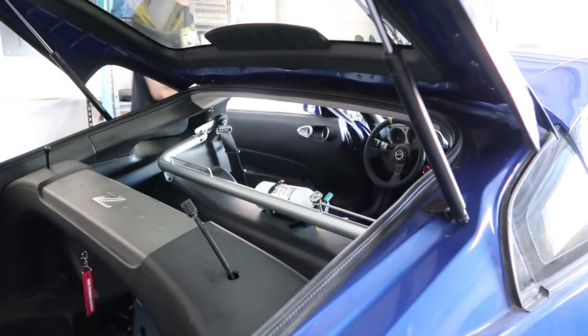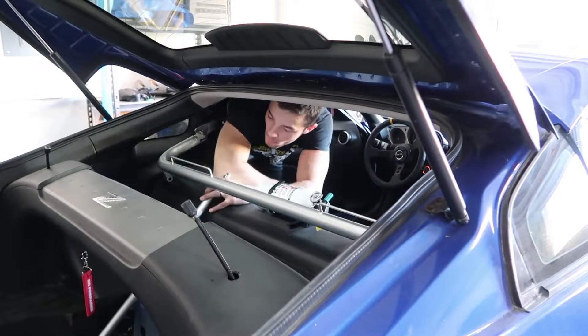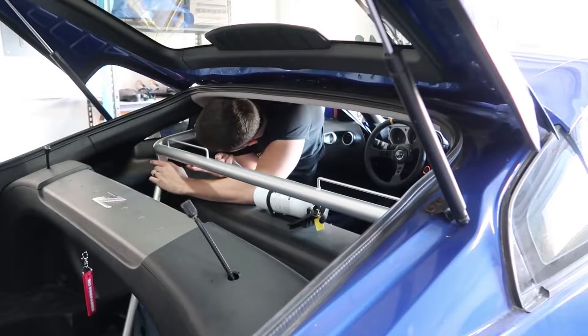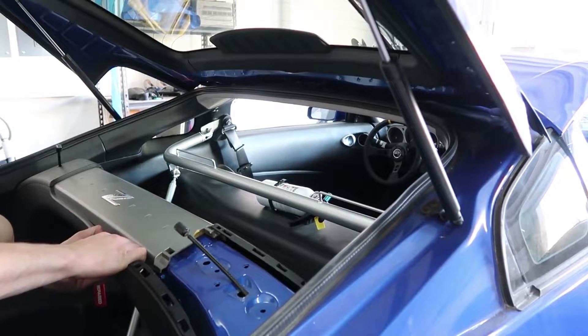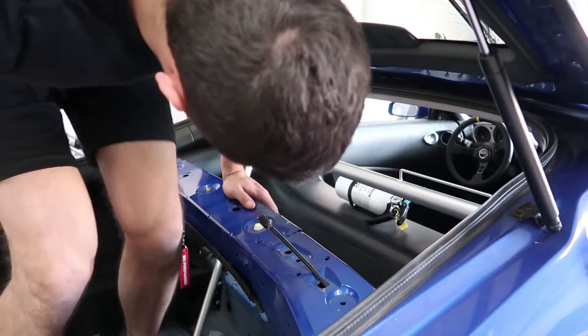In this install the harness bar actually comes first, so I removed the seats. You have to remove the top part of the seat belt because that's the same place the harness bar is going to connect to. The rear link to the harness bar is where my issues came — the bar would hit the speaker box or wouldn't have the right angle to bolt it to the floor. After a while trying it on and off camera, I got it done. There were two bolts that go to the regular seat belt bolts and two other nuts and bolts that go to the floor of the car.